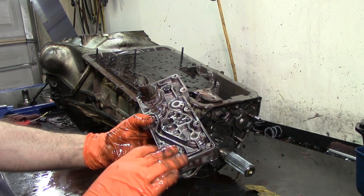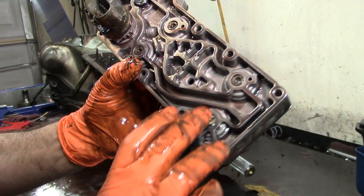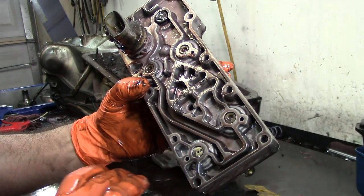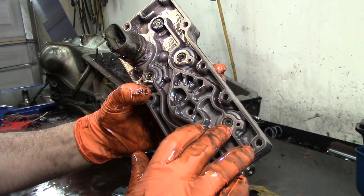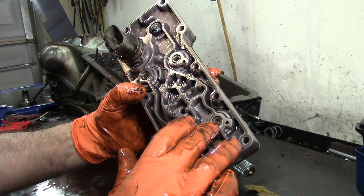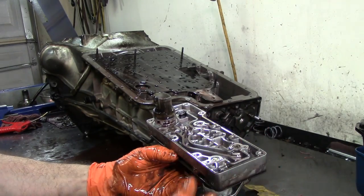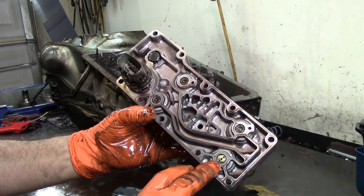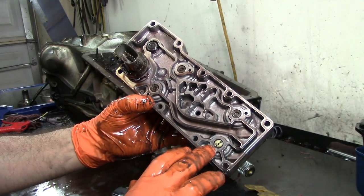The way to identify it is by looking at the torque converter clutch solenoid port. As you can see here, I have three little holes — this is an on/off solenoid. You can see the little ball seated on the solenoid. Whenever you have debris here, sometimes your solenoid is electrically good but you get metal stuck on there and it's actually bleeding off. That is very common — to have a solenoid problem. This is a PWM solenoid, and on the on/off solenoid packs you'll see another solenoid that looks just like this in this position.